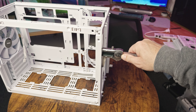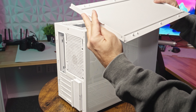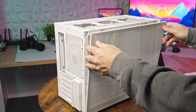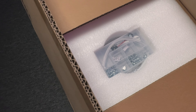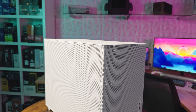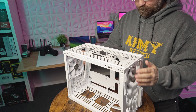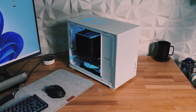The outstanding build quality and premium materials are what make the Sama IM01 Pro's versatility a reality. The entire chassis is crafted from thick one millimeter SECC steel, which is far from typical at this price range. Equally uncommon is the use of solid steel ball studs welded directly onto the outer panels — designed to endure, unlike the plastic variants common in similarly-priced cases. In the off chance you damage a plastic securing clip, Sama has replacements covered. Once panels are in place, the tolerances are exceptionally tight, with no noticeable panel gaps or misaligned edges, and the internal chassis remains rock solid with no flex or wobble.